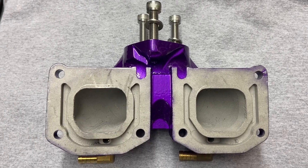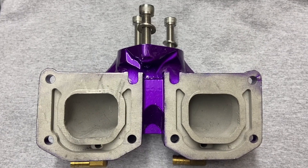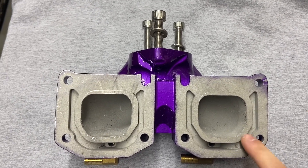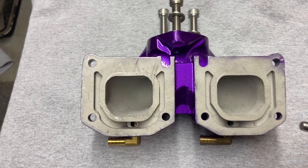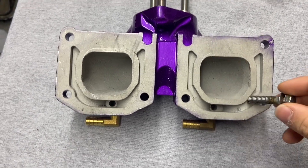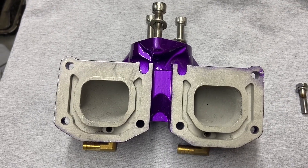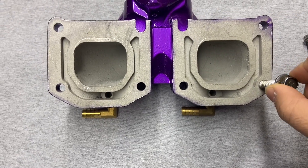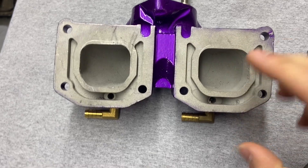Today's video I'm going to be showing you port matching or opening up the exhaust ports on a 61x manifold to match a 62t. A little backstory — this is a Wax Racing manifold for a 61x. The 61x manifold bolts fit perfectly fine, but the problem is 62t cylinders use a bigger bolt which will not fit, and also this is a different exhaust port sizing.